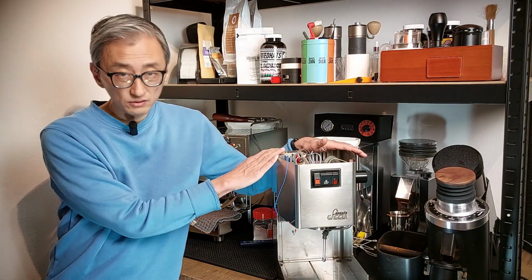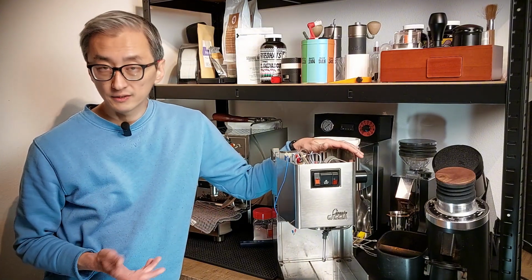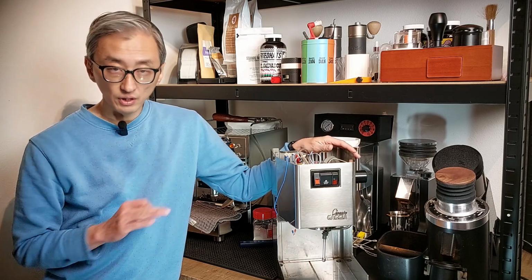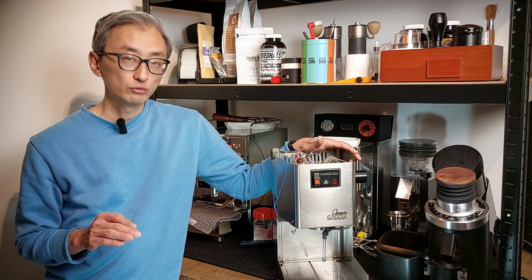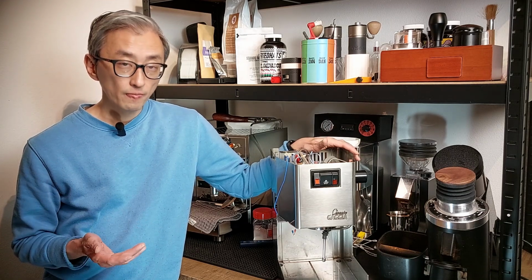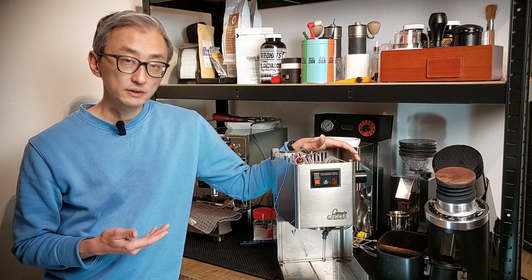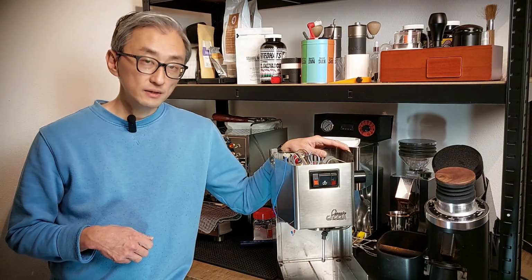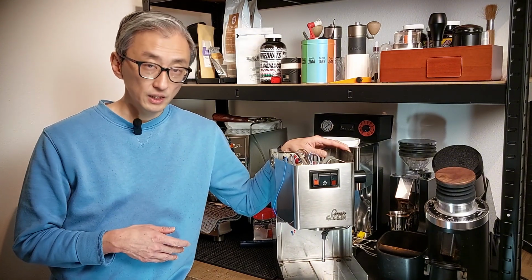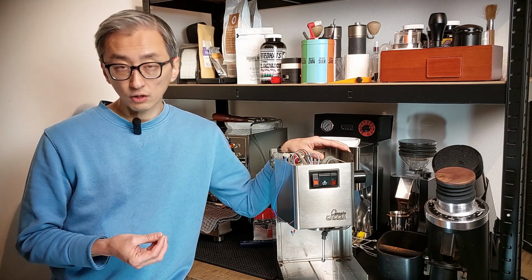And if you bought second-hand, like I did, or if you're using tap water and didn't descale regularly in the last 2 years, or if you didn't descale at all in the last year, I would recommend sending it to a technical assistance, or maybe opening the boiler yourself to inspect and descale the machine. In this case, I wouldn't throw a solution of citric acid and run it through your machine, exactly because those flakes may be released and clog some parts.